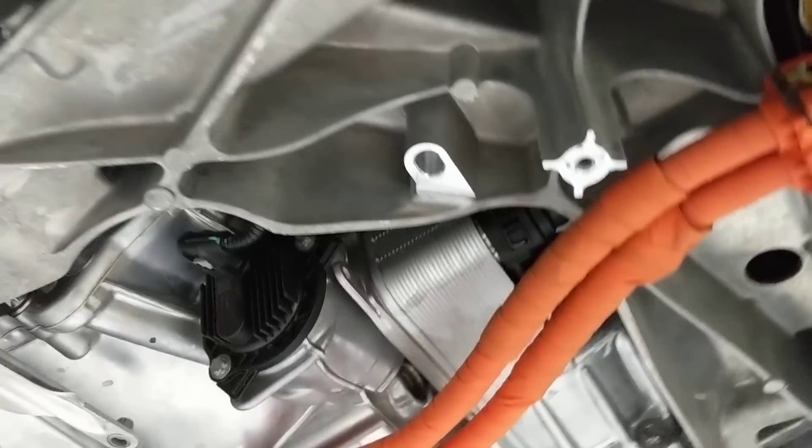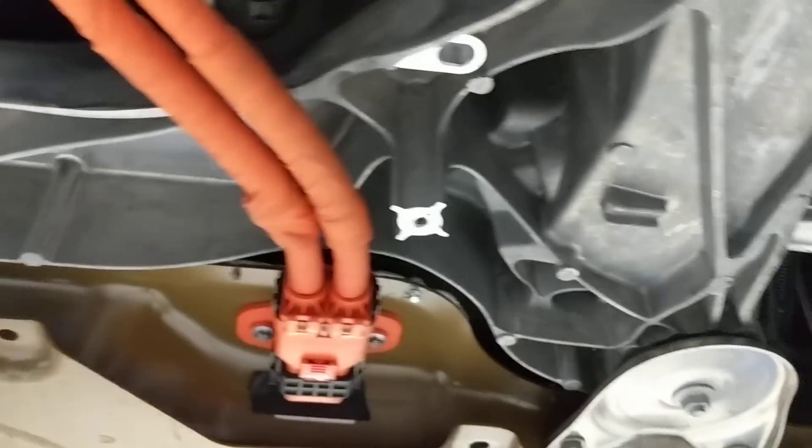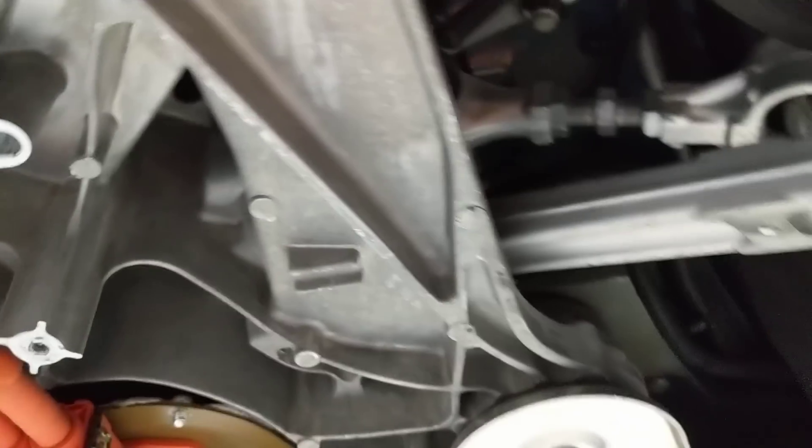The owner who graciously allowed me to photograph this car doesn't want me taking the motor apart, and I can understand that — so that'll come later. I've got a GoFundMe for buying one of these to do a full teardown — the link is in the description. It looks like the only electrical connections back here are these high-voltage connectors, and the only cooling back here is for the motor. All the rest of the battery cooling, data connections, and the DC-DC converter and PCS — all that's going to be up front.